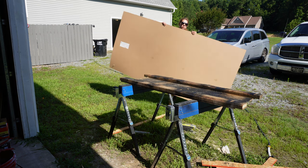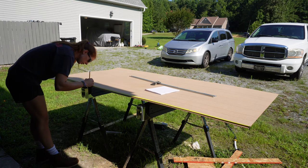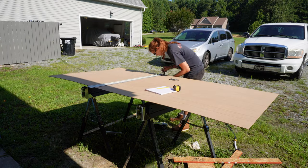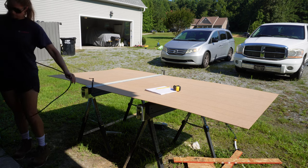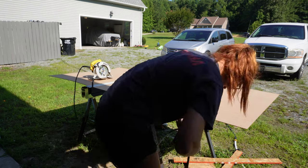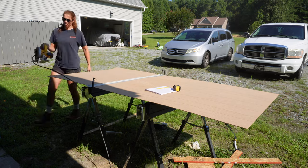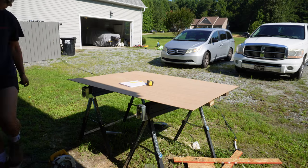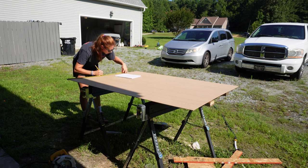I'm using true quarter inch plywood here instead of that eighth inch MDF. That's only because I don't have any seams I'm going to have to match up, so I can use whatever paneling I want. I like this because it's thicker, and if it ever does get wet again it's not going to rot the inside of the wall as quickly as MDF would. If you want a full video on how I cut these weird angles, I do have a video on my channel. I actually did it differently this time and I like this way a whole lot better. You live and you learn.